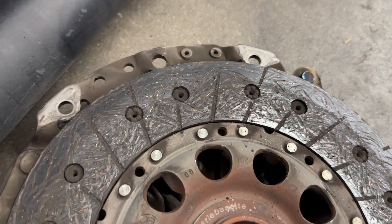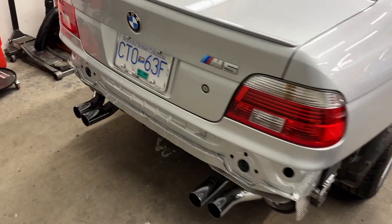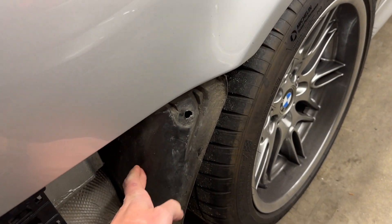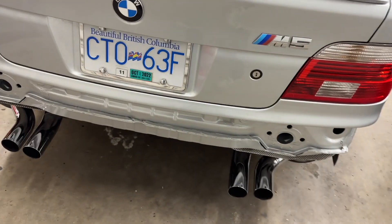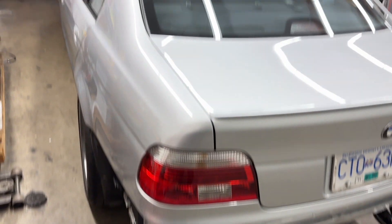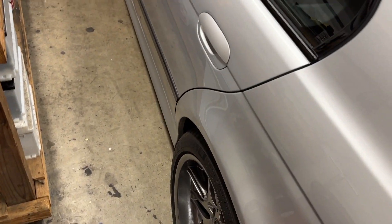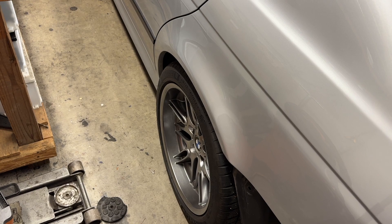Here's the clutch disc — I'm seeing a lot of wear on the outside edge, but certainly still some life in that. The Canadian car had its rear bumper taken off today — that was the one that was hit and damaged. Thankfully everything else is fine. Sergio did a really nice job cleaning up the bodywork under the bumper. No damage to the quarter panel, fender liner's fine, and the guide mount seems totally fine. We'll have the new bumper back from the paint shop tomorrow with the old diffuser repainted, so that'll be going on tomorrow. We also had two other complaints: some rear speakers were buzzing — I adjusted the parcel shelf and DSP settings and fixed that. We also had squeaky brakes, so we went out and bedded the new pads and rotors in again a little harder, and the squeaks are all gone. We weren't really happy with how the parking brake came out before, so we put new shoes in there and it's working great now.